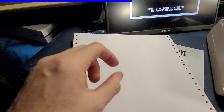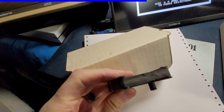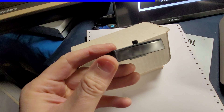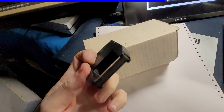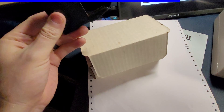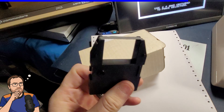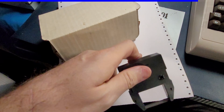The reason dot matrix printers survive is because they use pins that kick out and push against a ribbon. This is the ribbon cartridge - the one I took out of the printer - it's just a spool of inked fabric. The tiny dots in the print head push against it and mash up against the paper to give you a print. Because it's physical, not laser or thermal, it can actually push the pins into the paper, which transfers that image to the copies below.